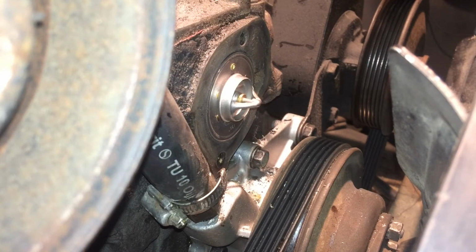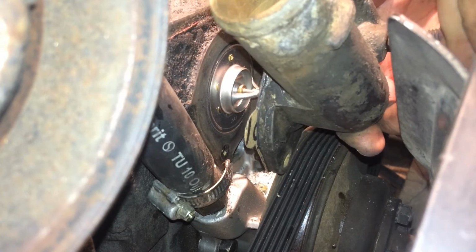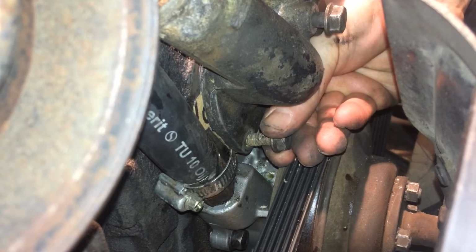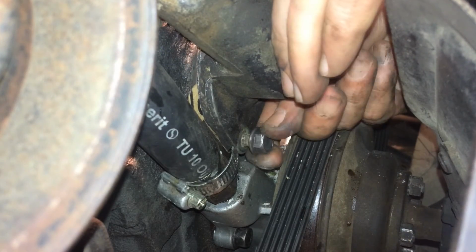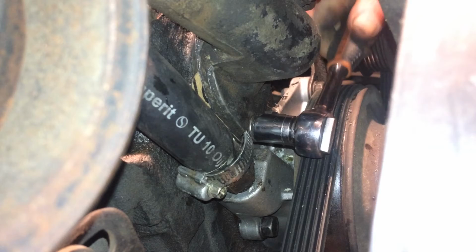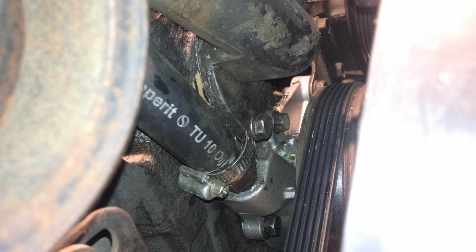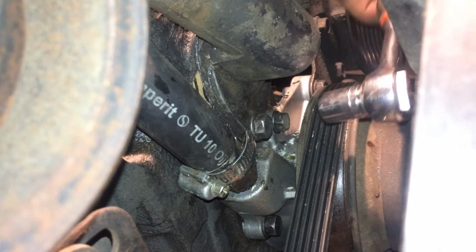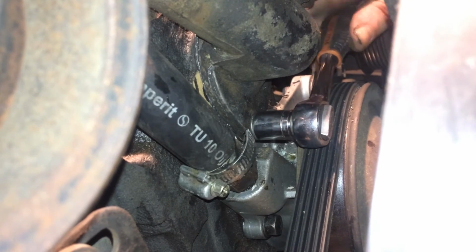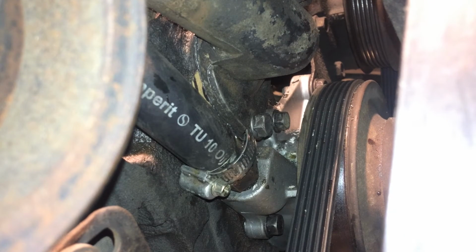There we go. So basically, you see, that's a little bit off angle, but it's still pretty straight. So now I just need to get this back on there without dropping the gasket. Here it can be good to have the bolts in as directional pins. I just screw them in by hand, and then I take the bottom one and we fit that one in, and you will feel when you're in the right spot. So I just put them hand tight now, and I'm going to wait for about 1 hour according to the instruction on the Permatex Ultra Black, and then I will torque them to 17 Newton meter or 13 foot-pounds.